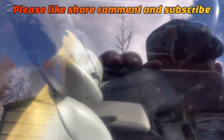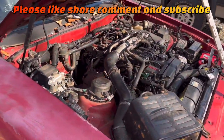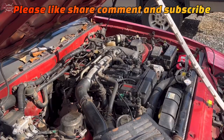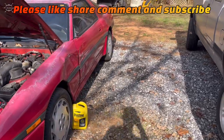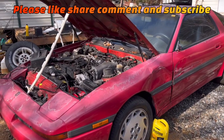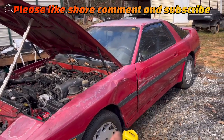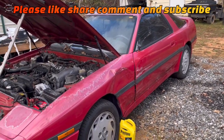Look at this thing y'all, it's mint inside other than the dash. This lady took good care of this car - she had the interior redone, had it painted and everything, then had a blown head gasket and it just sat for a long time. But we're getting there - it runs. It's running rich though. I don't know if my O2 sensor's bad or what's going on with it, but we'll get it figured out - or it could just be off another notch on timing. I just wanted to show you all this one because this is the newer project car, not mine - somebody else's that we're messing with. We got it running already, just got to get it tidied up. We're gonna go through and replace all the hoses since they're all pretty bad off. Eventually they're gonna get a door and a fender replaced too.